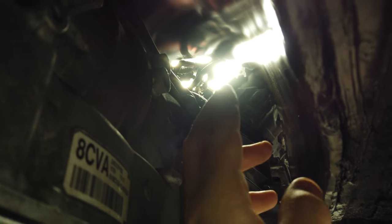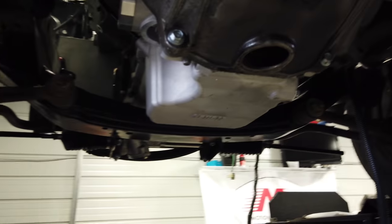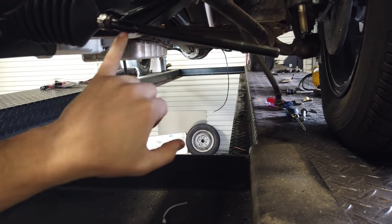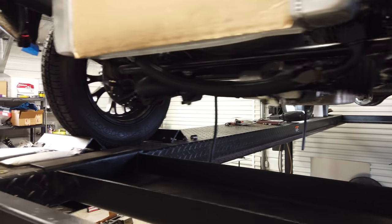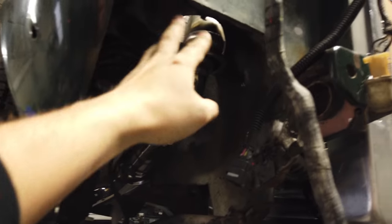Here's the tunnel from the bottom side — I definitely gained a bunch of clearance so I can get up to the bolts. I ended up leaving the tunnel really big up above so the direct-injected pump and wiring can tuck underneath the firewall — that's what I had to do to get the engine set back a little bit. The 6L80's in, engine's in. While the car was out I ended up fully welding the brackets for the steering and all of that. I still need to finish up the arms here — got them cut, just need to make a little sleeve so it fits tighter. Then I should have steering in the car, and I also need to cut a piece of three-quarter-inch tubing for the actual steering shaft.